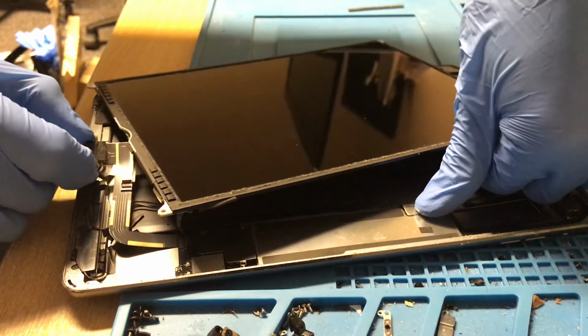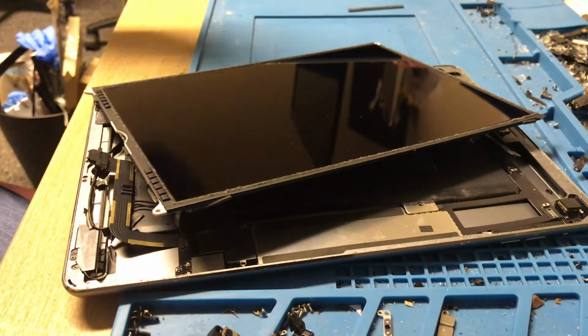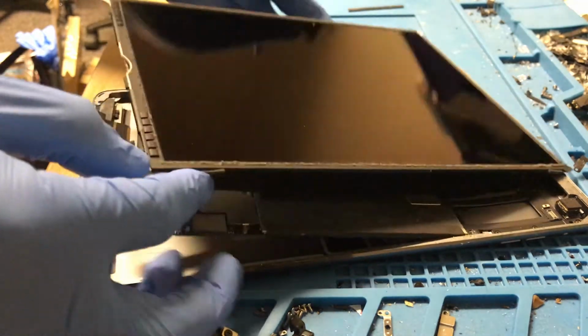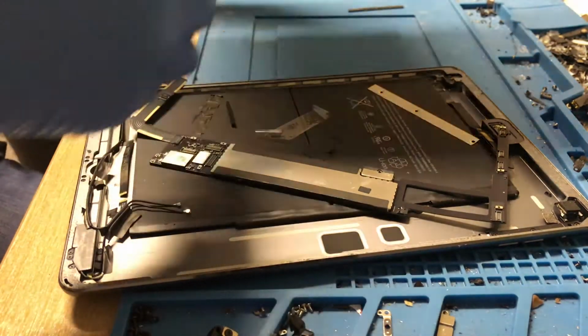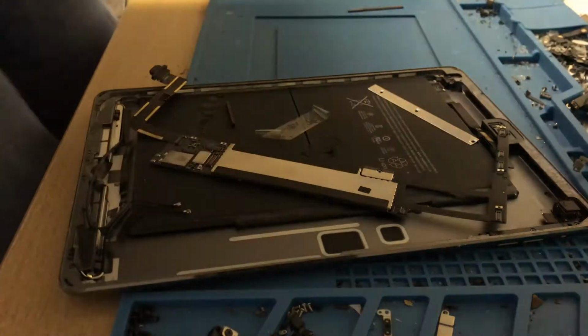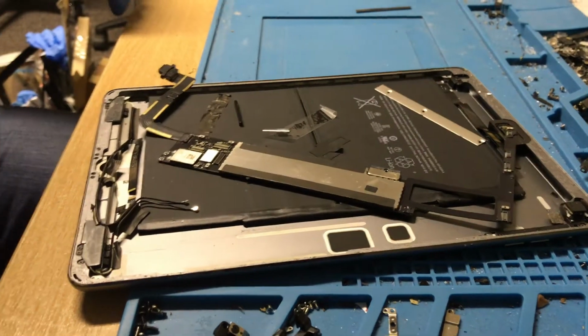So maybe that one pad that pulled was an important pad. I'm going to have to go and have a quick look at that, check schematics and check that that pad was actually joined to the other ones. If not, I will run a quick jumper and we will be back up and running. So I'm going to leave the video now and I will be back in a moment.